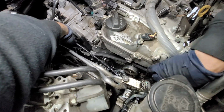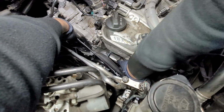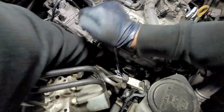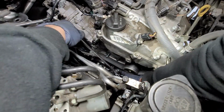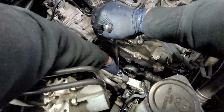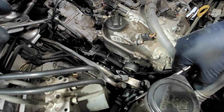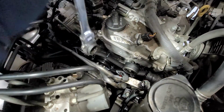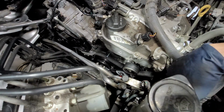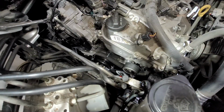This coolant hose is up the way. We're gonna go ahead and feed it. All right, so pay attention to your grooves. Make sure that they're all inserted in the belt. If they're not, then you're going to be needing a new belt pretty soon. All right, so we're all set and done. We're all grooved in. And now we're going to put in our thermostat housing.